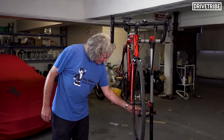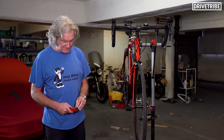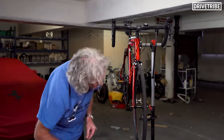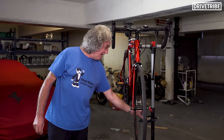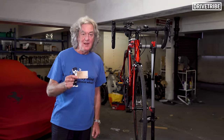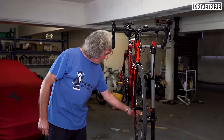Now I'm going to show you how to do it. You will need something to undo the brake blocks — in this case this is Shimano 105, it's a four millimeter Allen key. On some Campagnolo it's five millimeters and on some older bikes it will be a 10 millimeter nut. You also need a credit card. I am obviously a keen eco warrior so I'm using my British Airways Executive Club gold membership card.